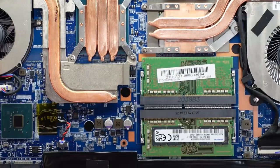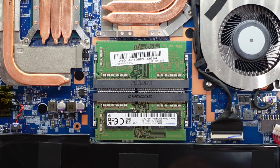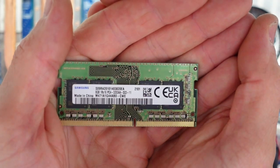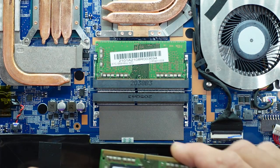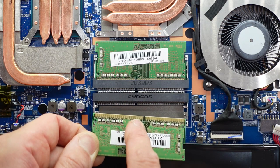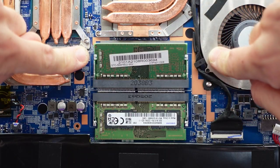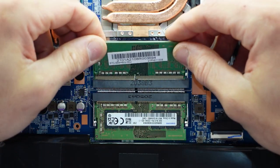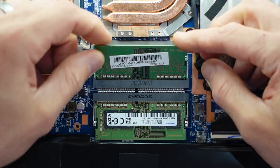Once you've done that, you're free to upgrade your RAM, which is very straightforward. Pull these two tabs out and it should flick up. We've got Samsung 8GB PC4 3200MHz — just fine stuff, nothing fancy. When reinstalling, make sure to line up the notch on the RAM stick with the notch on the slot. Slide it in and push down. Slide it into the groove so those copper pins are hidden — if you can see them it's no good.